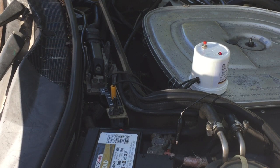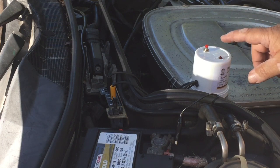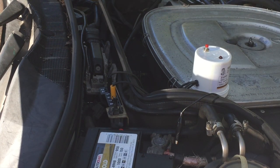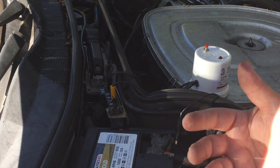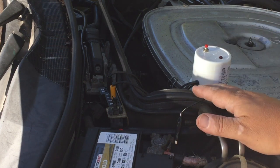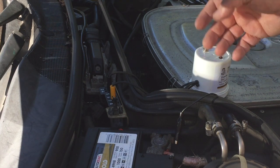There is one small problem with old Benzes. When the LED is lit the moment you plug it in, most likely one of your relays has cobwebs — a stuck relay or something similar. Unfortunately it doesn't tell you which one, so you'll have to open up the black relay box and unplug them one after another to find which one is causing the LED to stay on.